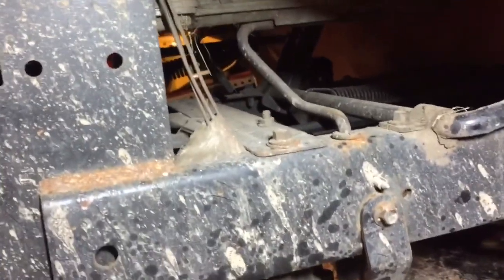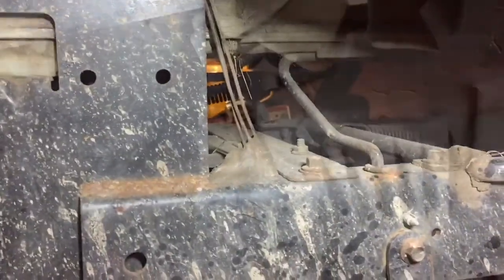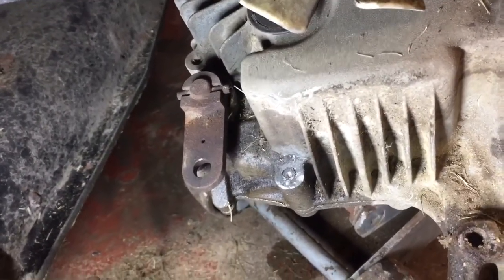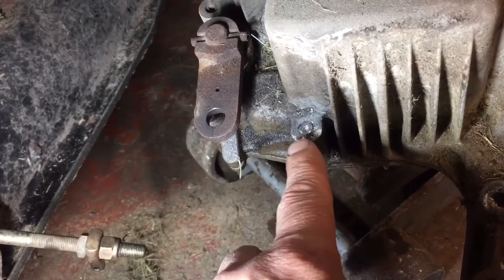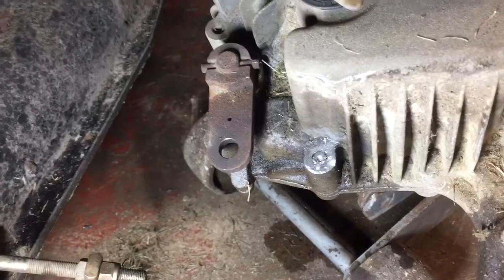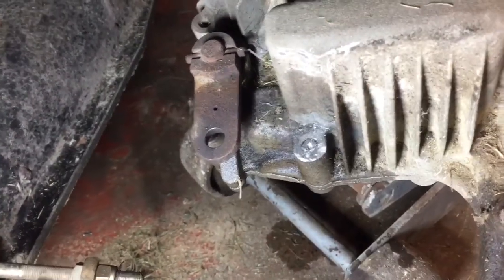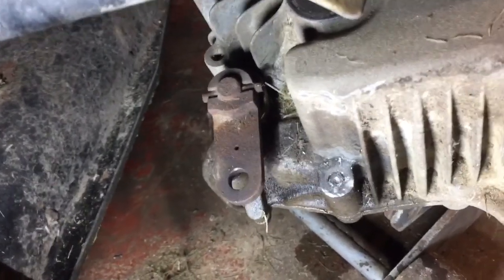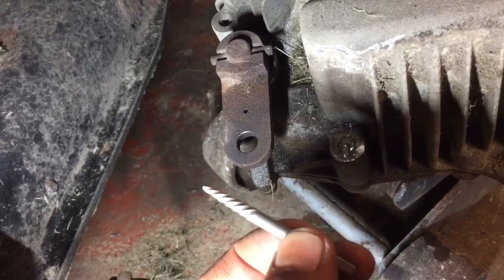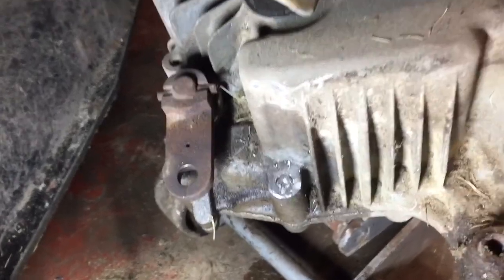Imagine the drive belt, and find out what else. All right, I was able to get a little better access at this bolt here that had snapped for this hanger. I'm able to tip it, get perpendicular access to it, and so I center punched it. I drilled it with the 7/64 bit for this. I believe it's a number 2 easy out extractor. See if we can get that bolt out that way.